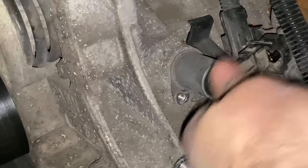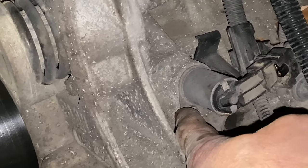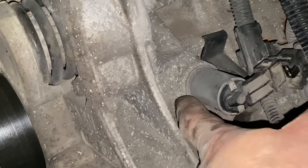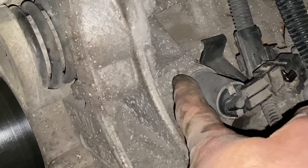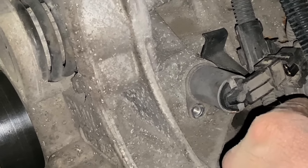If you start wiggling them up and down, you'll snap this electrical body off and you'll leave this bit behind. It's an absolute nightmare then. You're going to try and fish it out. The problem is it's aluminium, and inside is aluminium, and the slightest bit of dirt in between this block and this solenoid and it just gets jammed in, you know.